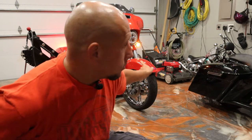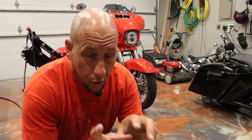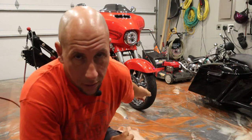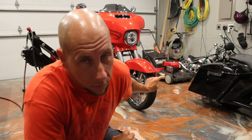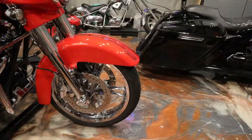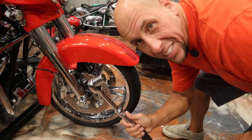These aren't very hard to do, it's just kind of tedious - there's quite a bit of parts that you got to pull off. Pretty simple process especially if you have the right tools. We're just gonna go through the steps: gotta take off the front wheel, calipers, fender, fork legs, and then the cowbells come off, then we just reverse the process. Need the big 15/16.